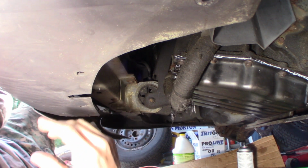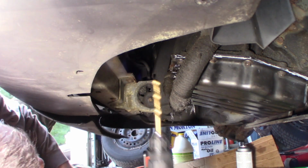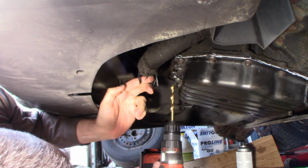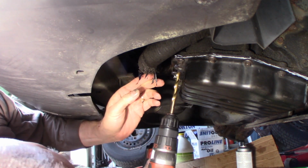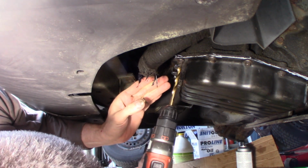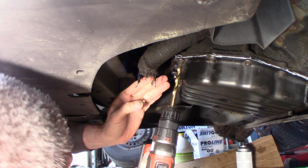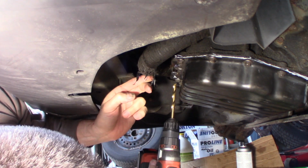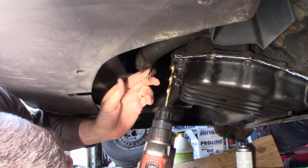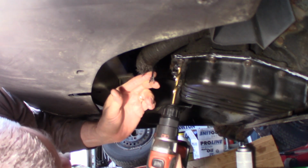Alright, so what I found, I'm still deciding exactly what I'm going to do with this, is that 2 of these bolts have already been stripped out and the helicoil's in there, and this one's no good. So I'm going to put a helicoil in it. Fortunately, I can fit this inside and put a new insert in here. At least looking at this one, I couldn't see the other one. It didn't look like they broke the tang off of them when they finished, which you should do, but I'm going to drill this one out.